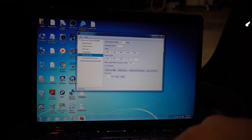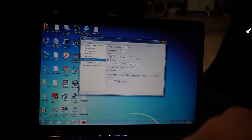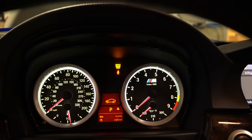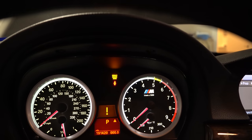So first thing I want to try before anything is activating that gauge sweep. So what we're going to do is go to the warning zone here, read - it's inactive. I'm going to click activate, write to ECU. There you go - it reset my gauges and you can see that moving down and then up to 5,000. So pretty cool - you can see it working. Let's turn the key off - you can see that drops down, and you see it comes up to 5,000 and if it slowly settles down.